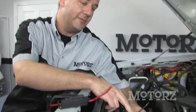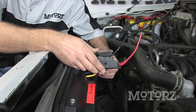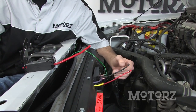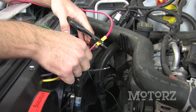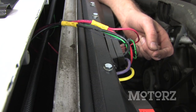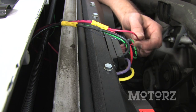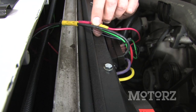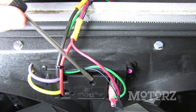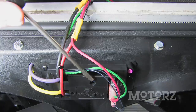There are two more wires to hook up — your positive and negative go straight over to the battery, and you can use the provided fuse holder from Flexalite to do that. You can optionally hook up your control unit to go to your ignition or a switch inside your vehicle. We decided to hook it directly up to our 12-volt power source. Now tidy up your wiring, turn on your vehicle and the AC, then adjust the screw counterclockwise for a cooler setting or clockwise for a warmer setting.